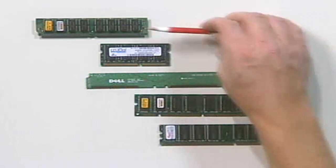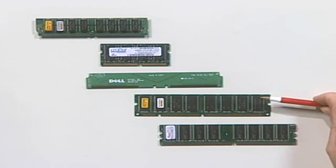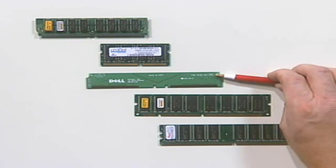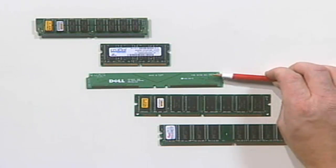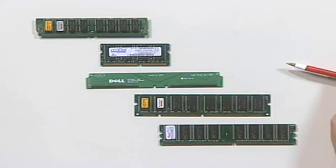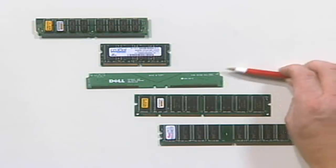Now, RIMs work very differently than SIMs or DIMs. One of the key differences is the fact that every memory slot on the motherboard, when you're dealing with RIMs, has to be populated. That means that if you just install a single RIM, because a RIM, by the way, is 64 bits wide, so if you were installing it in a motherboard that used a 64-bit data bus, you could install RIMs singly. If you did so, say you installed a 512 megabyte RIM in one memory slot of your motherboard and you had 3 empty slots, well, those 3 other slots have to be populated.